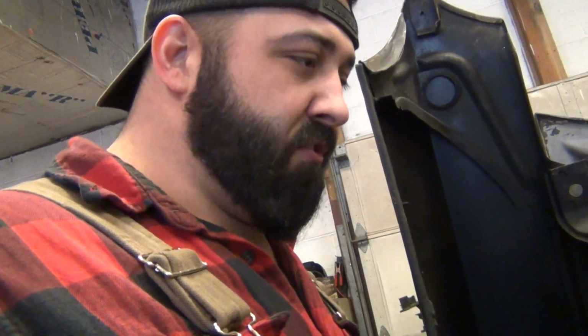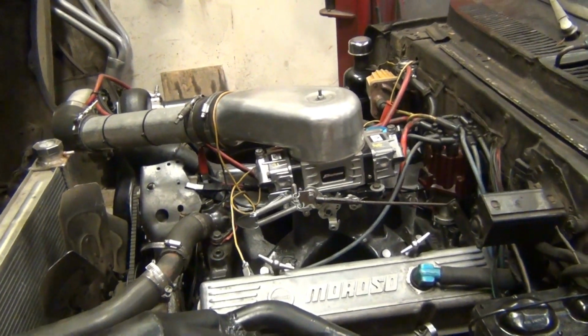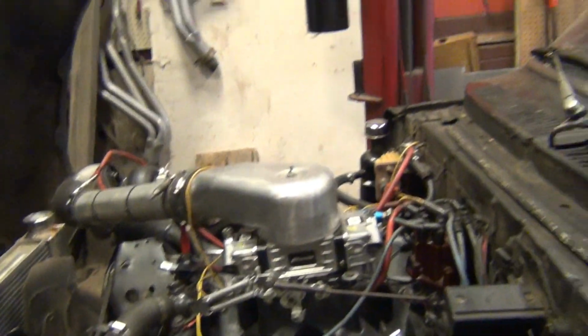Carla told me last night when I got to the house, she goes, "There's something silly that you're overlooking. You just need to step back for a minute and think about it." And I got to looking on that MSD forum and found out about phasing that distributor. And sure enough, that's exactly what it was. I was just overlooking something silly. Fires right up, no pump shock, nothing. Oh, it's good. Good, good, good.